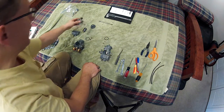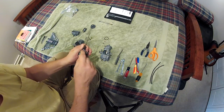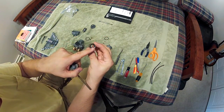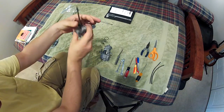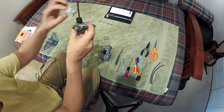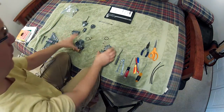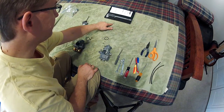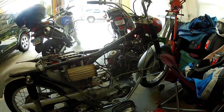As for the petcock, I went ahead and assembled it with a brand new bowl with a rubber ring in there, and reassembled the switch with the rubber seal. There's also an o-ring for this screw that I bought to replace the ripped-up one. You put this up against the fuel tank, then reverse-thread the bottom and positive-thread the top by turning it, and it joins the two together with a rubber ring. Once all assembled, I'll take the choke connecting arm and put the washers and hair pins through so those are good to go. I think that's it for assembly — let's see if we can get these carbs back on.